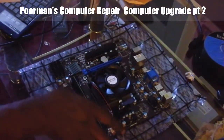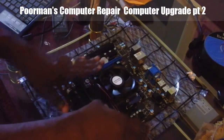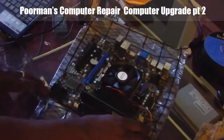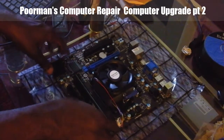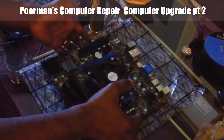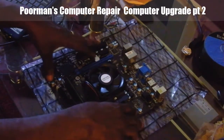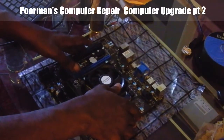So you definitely can't say, oh, screw it, toss. Another reason I decided to put the RAM chip and the processor in right now is that I have a lot more room to maneuver. I can easily turn everything around without worrying about lifting a big, heavy case. And two, it's on an even, flat surface, so I won't put undue pressure on it. Also, had I put it into the case, I would have had to press down on the mounting screws, possibly warping or cracking the board.